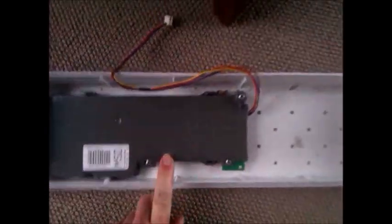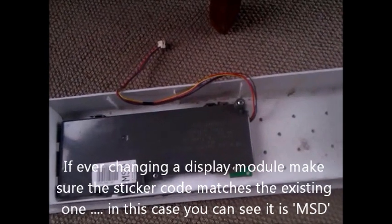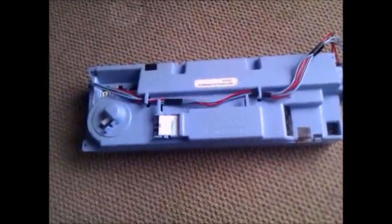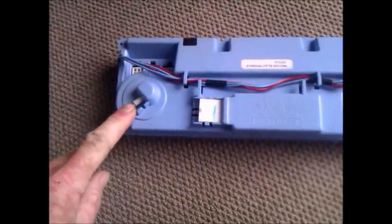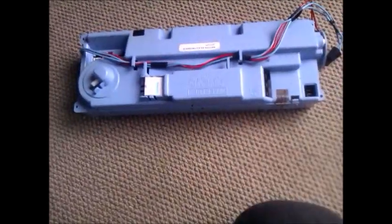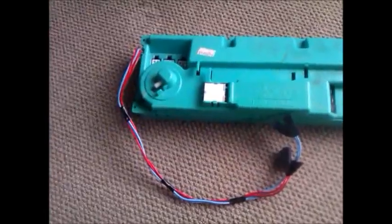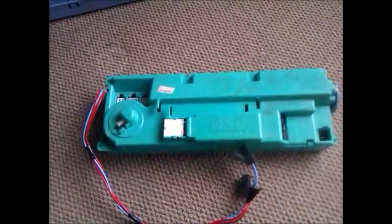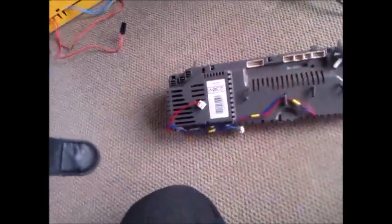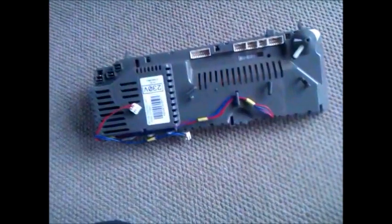There are five different color codes for these Smart Drives, phase one through to phase seven. Phase one, produced 1991 to 1993, were blue but did not have a pressure pipe on them. Phase two were blue with the pressure tube, produced 1993 to 1995. Phase three, 1995 to 1996, quite rare — they were green. Phase four were yellow, 1996 through to 1998. Phase five, 1998 through to 2001, was split into series 9 and series 10, and these were dark gray.